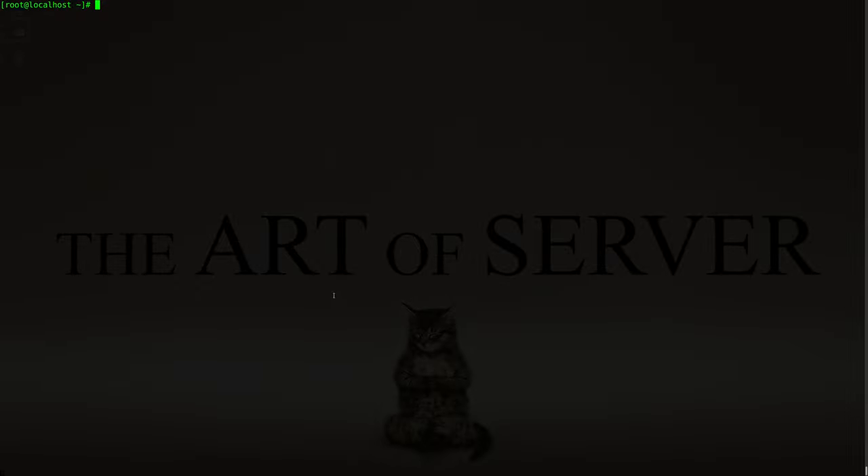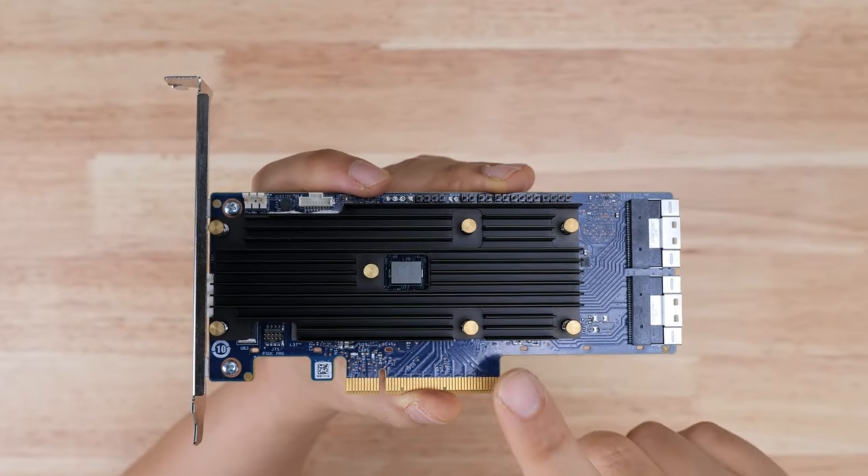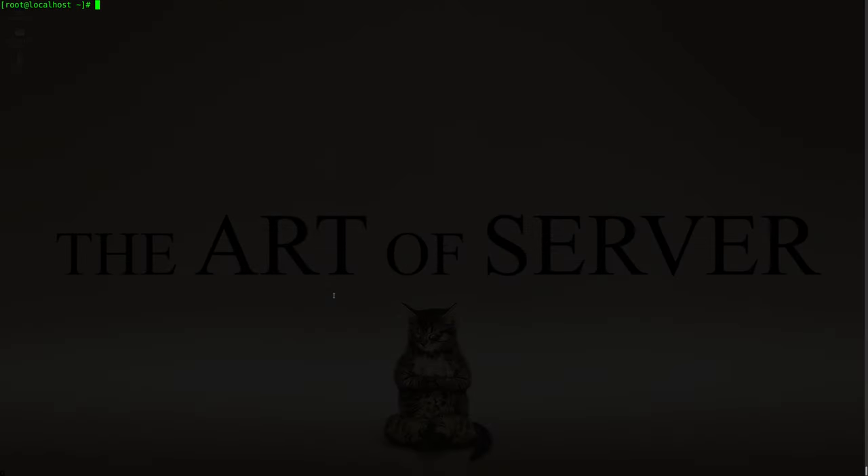Before I started investigating these comparisons, my hypothesis was that NVMe drives would perform best being directly connected to the PCIe bus. A direct PCIe connection removes any potential limitations that might be introduced by sticking a controller between the NVMe drive and the system. My initial expectation was to learn how much the MegaRAID controller would hinder the NVMe drives, but some of the results were not exactly what I expected. So stay until the end to find out what those surprising results are.